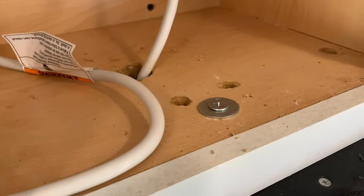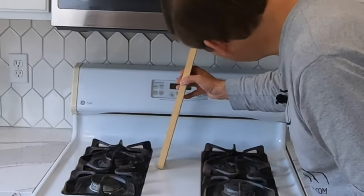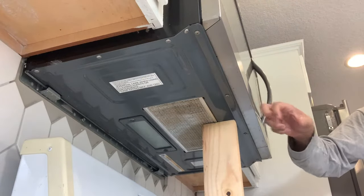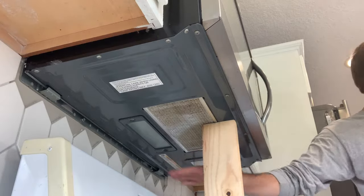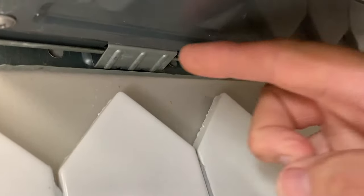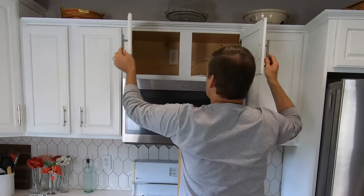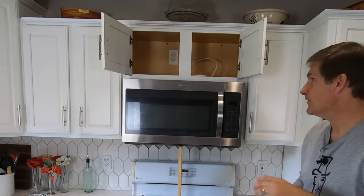So to take this out, what we're going to do — we have two screws, one on either end of the cabinet, and we're going to start by unscrewing those. But before we do, we've got to add some braces underneath. I already cut a board 17 inches, and it basically will fit snugly under the microwave to provide support, because these are hinged at the back. There's the hinge plate mounted on the wall — that silver piece is kind of like a hook that the microwave hooks into. There's one on the far end and one right here. The front will start to come down as I loosen those screws, so I want to support it somewhat as I take the screws out.